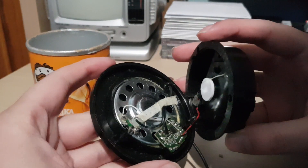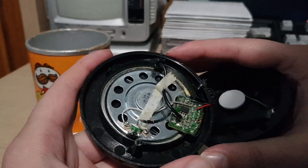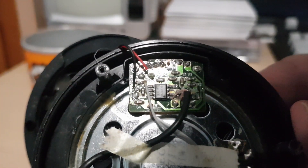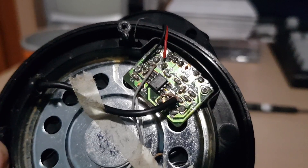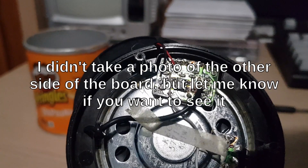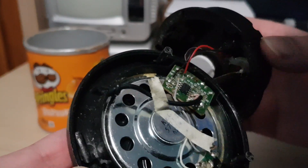And there's what's inside. The speaker is pretty thin — in fact, it doesn't have a lot of bass. The electronics over here are pretty simple. I don't know much about this type of electronics. The little chip there seems to have some marking, but it's so small I can't read it — this camera doesn't focus that close. Looks like it says LM4821, but it's so small I'm not sure. I have to take a photo of it and zoom in. It looks pretty dusty inside — obviously this thing is not waterproof or dustproof, but not much we can do from here.